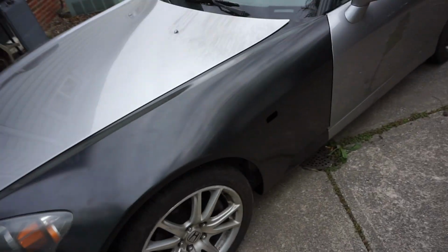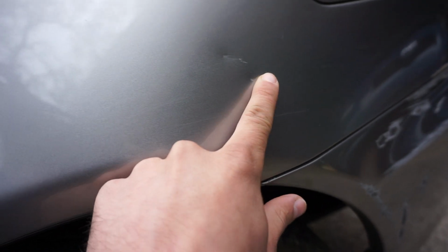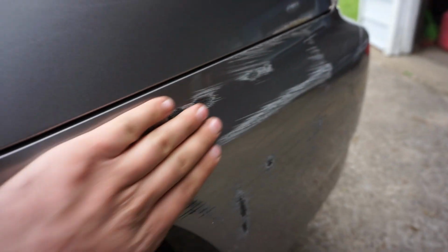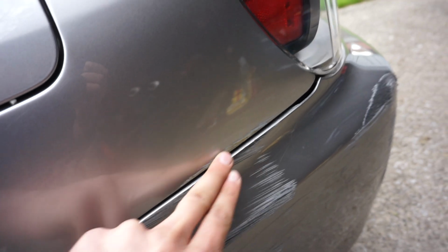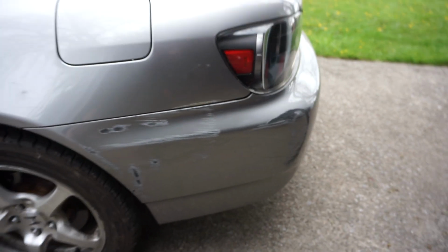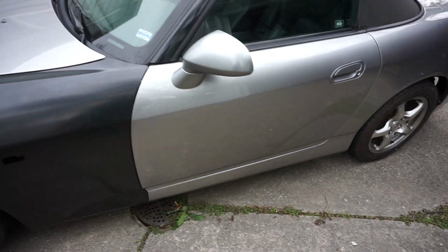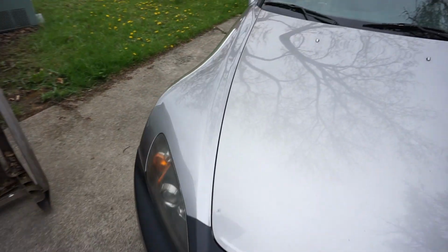And then going to the rear where it got touched a little bit, there are some fine scratches here. Two dents right there, a little dent there. And then the bumper got scraped completely. There's gonna have to be a little bit of pulling needed here to get that seam with the taillight pretty nice. So the rear bumper is gonna have to basically get all done. So this quarter panel, whole front end, blended with the doors, and that should be about it, honestly.